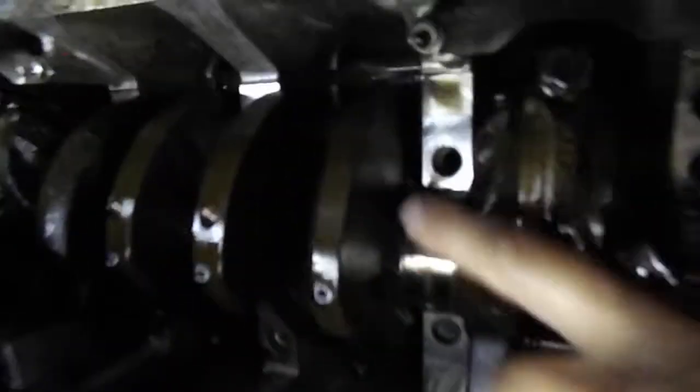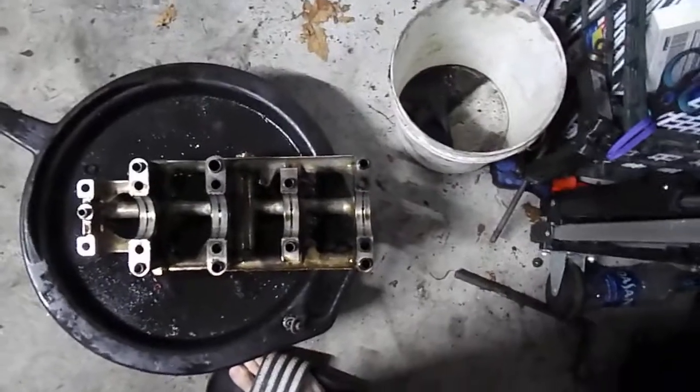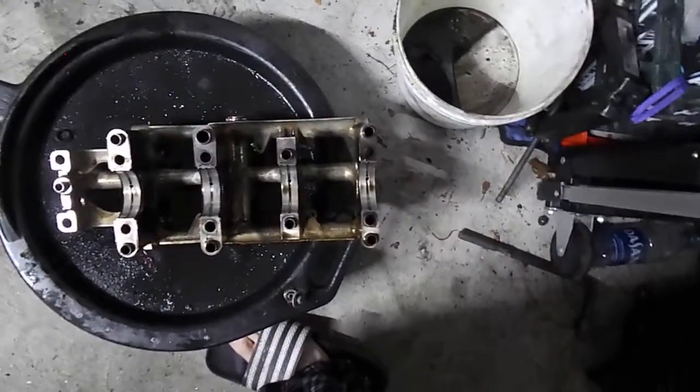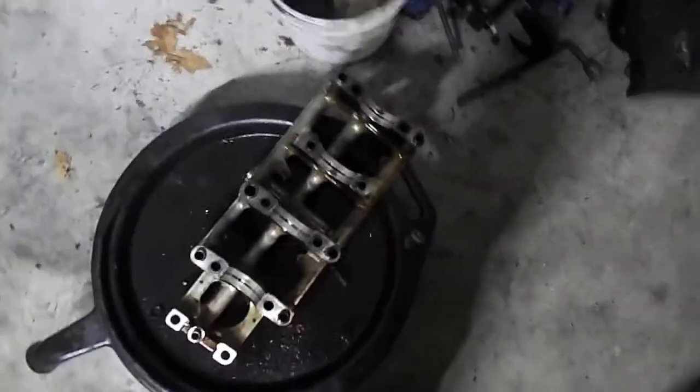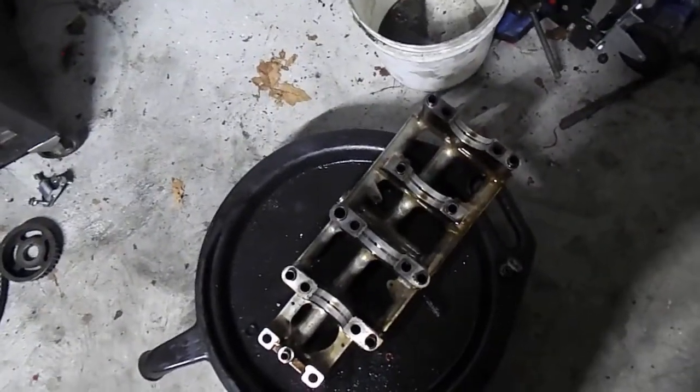The whole girdle — once you take out these 14mm bolts, and they bolt into one, two, three, four — you'll see 10 14mm bolts. Once you've taken them all out, that whole girdle will pull straight off. You might have to use a rubber mallet just to tap it to get it to come off, and maybe a screwdriver. So that's how you get that girdle off. You can do it with the engine in the car; it's really not that hard. It doesn't take that long, especially if you have the oil pan taken off already.